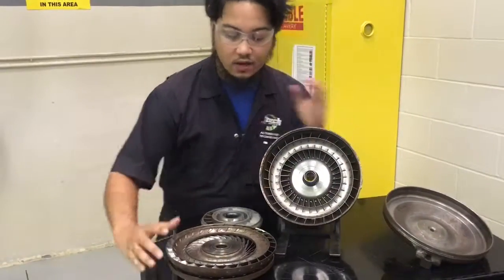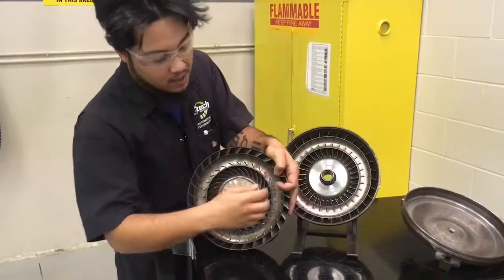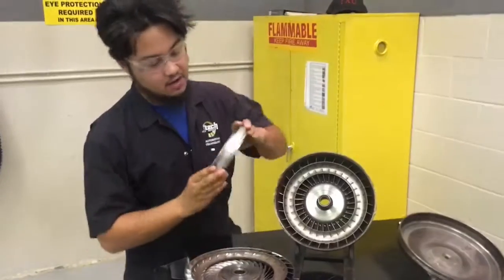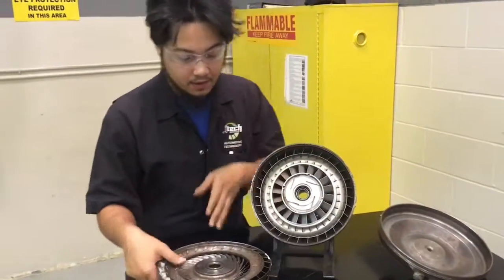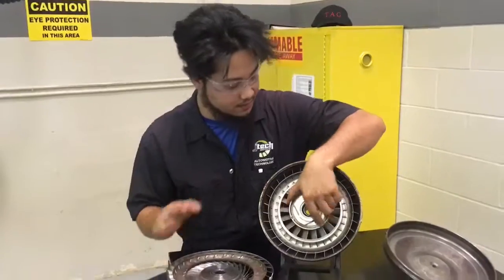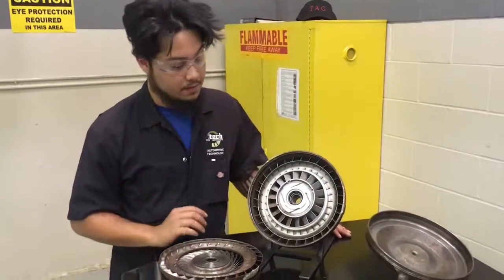After it goes into that, it goes into what they call the turbine, as you can see here. What happens after the fluid comes out of the turbine, it goes and hits these fans right here, and it redirects the flow to what is called a stator. When they're combined, as you can see, the flow redirect here causes a lock. And then that would be called vortex flow.